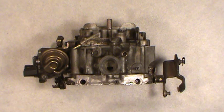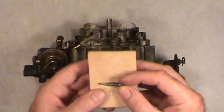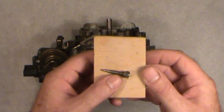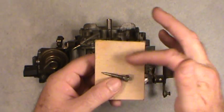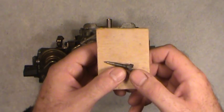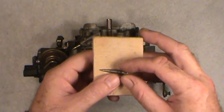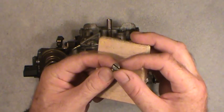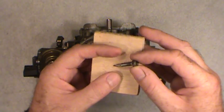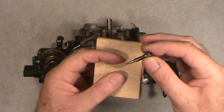I'll show you what the older ones used to look like. Most of the idle mixture screws, the ones earlier than this model, look typically like this. They had a tapered needle on the end — they all pretty much have a tapered needle, different angles mind you — a threaded portion, and usually a spring to retain the setting. And usually the older ones also had a screwdriver slot on the end so you could put a screwdriver in to adjust the idle mixture. Generally in a two barrel or four barrel carburetor you'll find two of these screws.